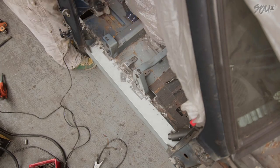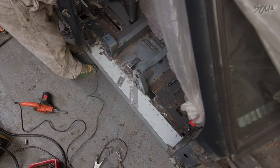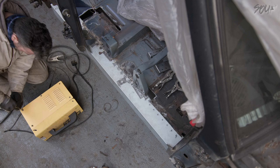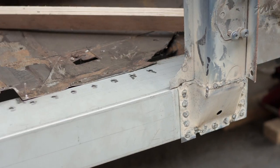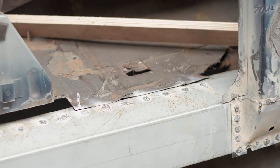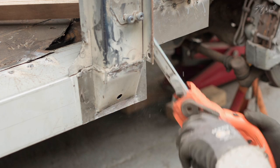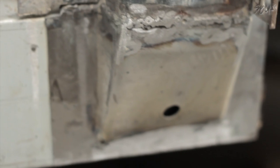The rear section of the floor here below the rear seat base was quite bad — I cut that out. Then there was a small repair to the welder; one of the feet came off, nothing serious. And then some finishing on the A-pillar and the plug welds on the sills. The A-pillar is great, except this one line here — look at this. I'm probably going to obsess about this every time I drive the car. I should have crisped up this line when I was folding the panel. I didn't, and I wish I had.